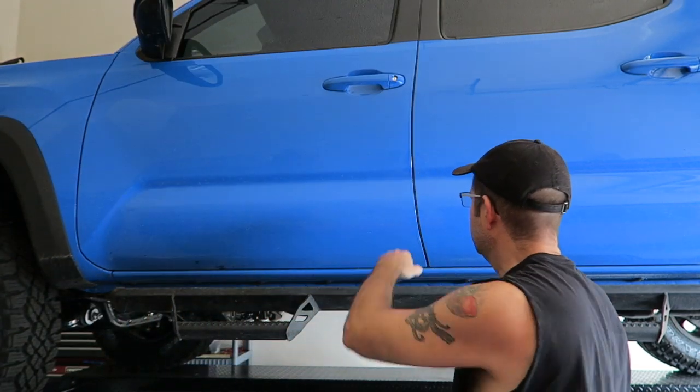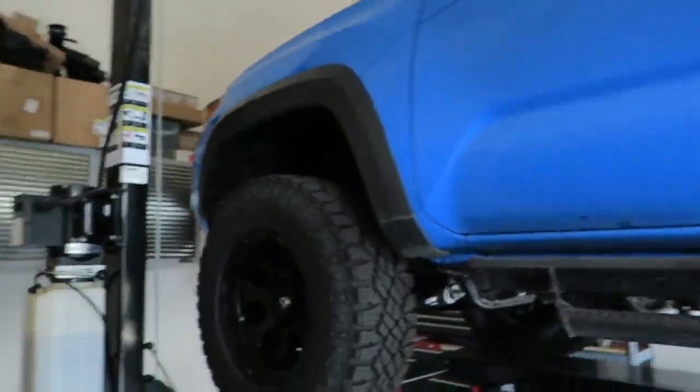But I didn't adjust it. So now we're going to go around and take a look. I have lowered my pressures a bit. I'm going to set everything about 3 PSI higher than what the truck calls for, so that would be 33 PSI. Let's shut that up and go take a look to see just where I am.